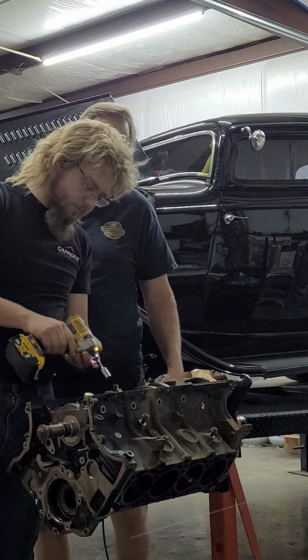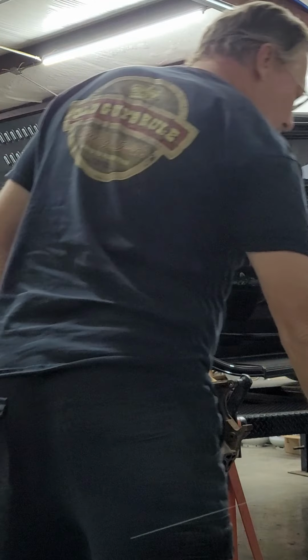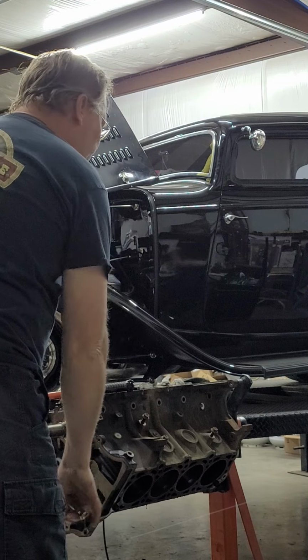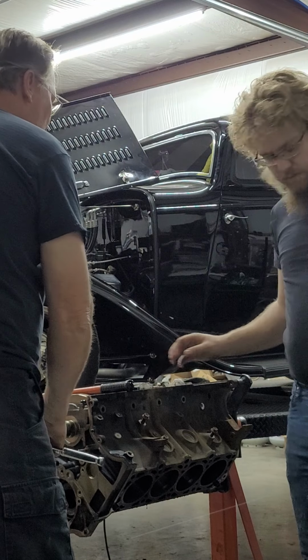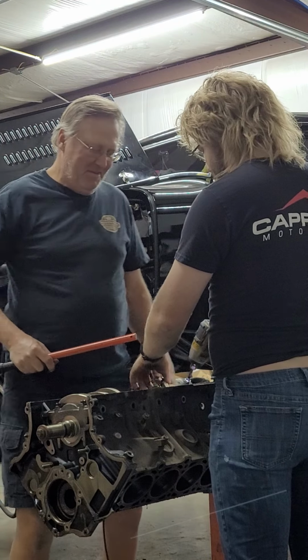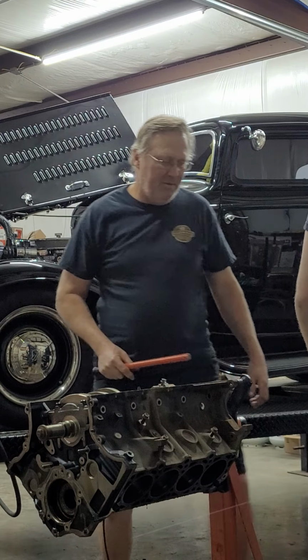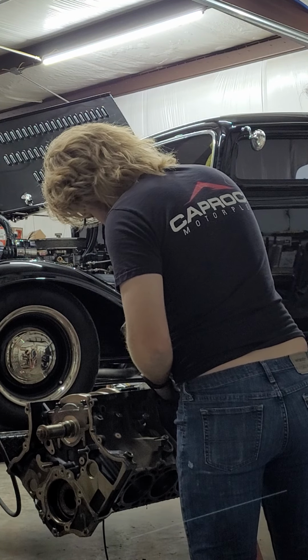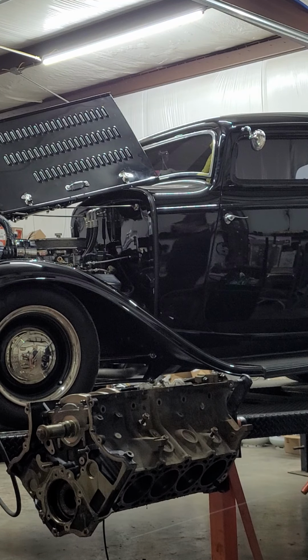And, going back to a guy I mentioned, I Do Cars, not too long ago. He likes tearing down bad cores to see what goes on in them. Sure, diagnose stuff. He wants to see which bearing spun. I forget what cylinder it is, but for some reason LSs, when they throw a rod, tend to always throw the same cylinder. It might be just a load thing on that cylinder. Generally if they throw a rod, I think it's cylinder 7. But anyway, there's more to be learned about an engine on teardown than there is assembly. That's all I can say.